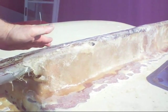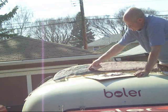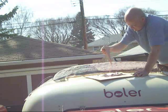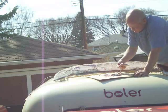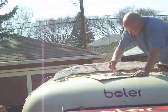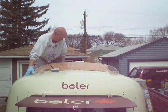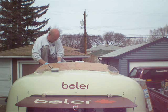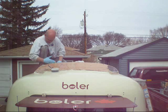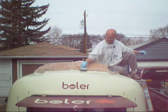There's a shot of the back there right now. I'll get some of that nice fiberglass cloth and bring it down as flat as I can. All this here I'll just touch up with Bondo in the end just to give it a little curve. Got that one layer of fiberglass on. I've decided this is pretty rough so I'm going to smooth it out with Bondo first, and then apply that last layer of cloth over the Bondo after I've sanded it down as smooth as I can get it. Notice with this on here my roof doesn't cave in anymore when I put pressure on it. I'm just bringing this down as straight as I can, and now I'm just going to saturate this piece of cloth that's coming straight down at the back.